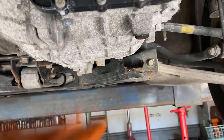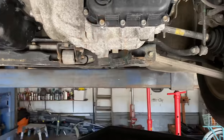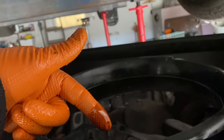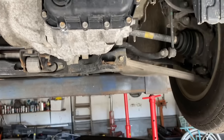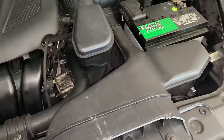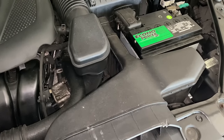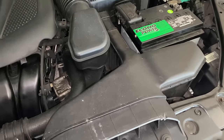The so-called 'sealed for life' is a bunch of malarkey. They're just making them cheaper so you can't check it — they want you to bring it to the dealer. Anyway, the transmission fluid that came out is very, very dirty. This procedure is for the Kia Optima, Sorrento, Soul, Sportage, Sedona, Forte, Rio, and Cadenza — pretty much 2011 and up — that have this six-speed transmission.